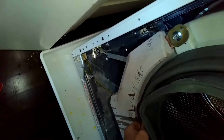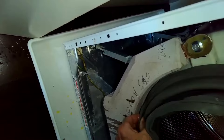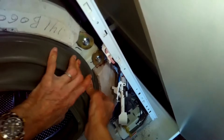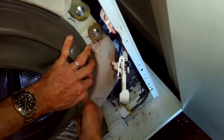Other manufacturers' boots are easier to put on — you don't have to stretch them and you can do it yourself. This one is a little bit tricky; the rubber is a bit thicker and seems to be smaller. Just make sure you've got it all the way on, all the way around. Use your thumbs to push in — one hand holds it and then push in with your thumbs at the bottom.